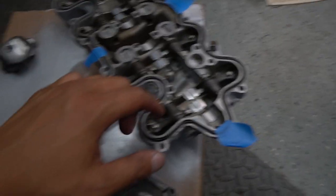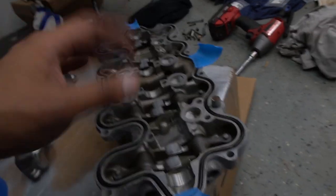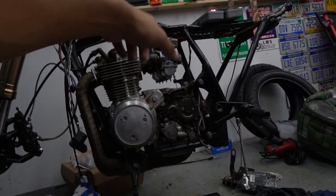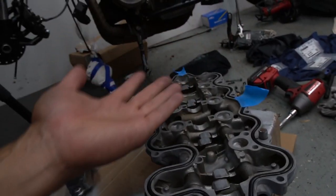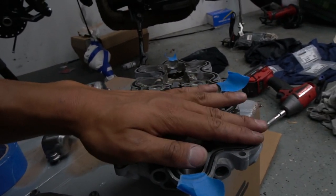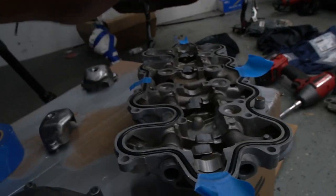Here's a little trick I learned over the years. When you have a gasket that needs to be mounted upside down, as soon as you flip the valve cover it's just going to fall out. So what I like to do is put blue painter's tape - you can do the same trick for carburetors too. Put the painter's tape so the gasket doesn't fall out even if you flip it upside down. Then you put it on the bike and slide the tape out from the side once you apply some pressure. This way the gasket stays in place and you can proceed and clamp the bolts as needed.